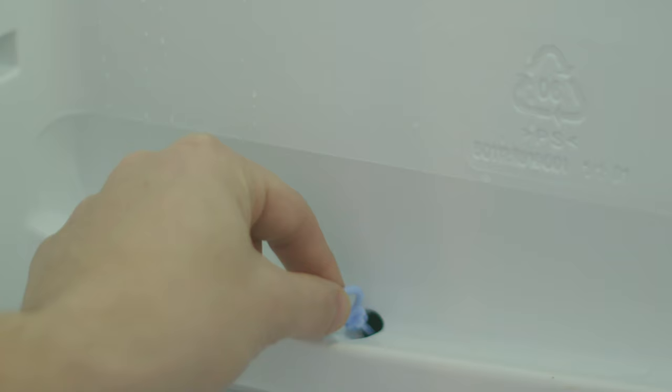Finally, try not to let any food or produce that you put into your fridge touch that back wet wall. Not only can this cause drain hole blockages, but it can also allow the water to bypass the drain hole completely and drain into your food. And remember to order any replacement parts like drain hole cleaning tools, or to book your local Hotpoint engineer, visit hotpointservice.co.uk.